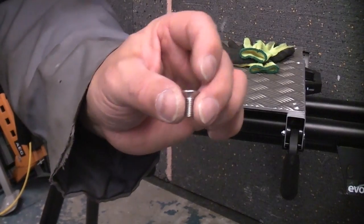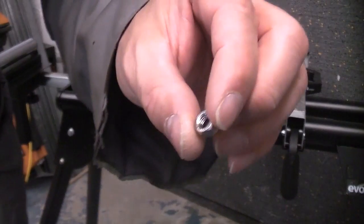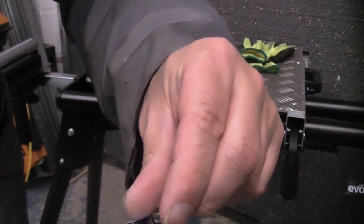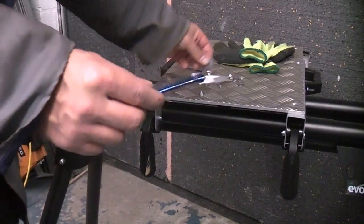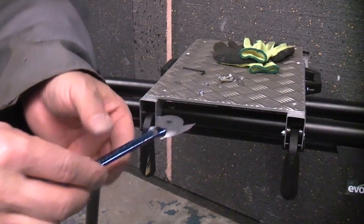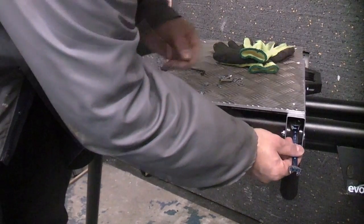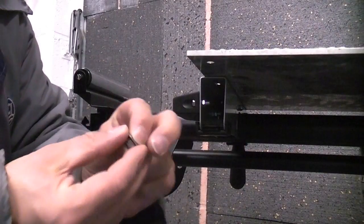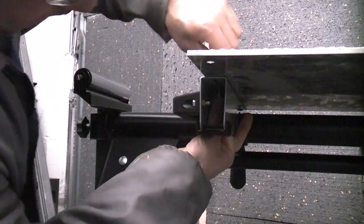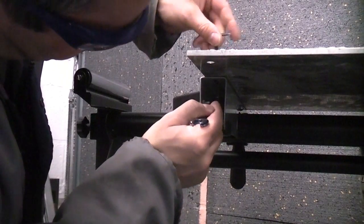This front bolt is a little bit difficult so I'm going to place it in the hole. I'm now going to take the spanner and put that into the ring end, ensuring that the blue nylock bit is facing down. I'm going to take the washer and then slide it in until we get the bolt started. I'm then going to push the bolt in, use a washer and the nylock again, and wind that up using the spanner.